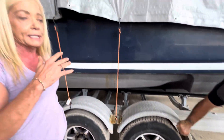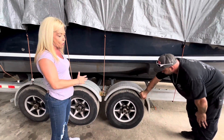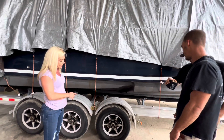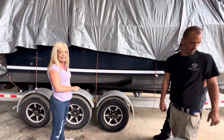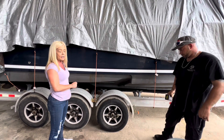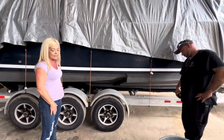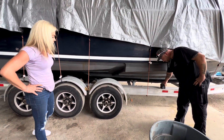So anybody out there with brakes and aluminum rims, really on any trailer, you should be rotating your tires or properly servicing them. It's also important with aluminum rims that when he picks up the trailer, he re-torques at 25, 50, and 75 miles because of the aluminum rims and lug nuts. He'll be back to check that — there's an engineer working on a new rim design where that doesn't happen. I'm interested to see it.